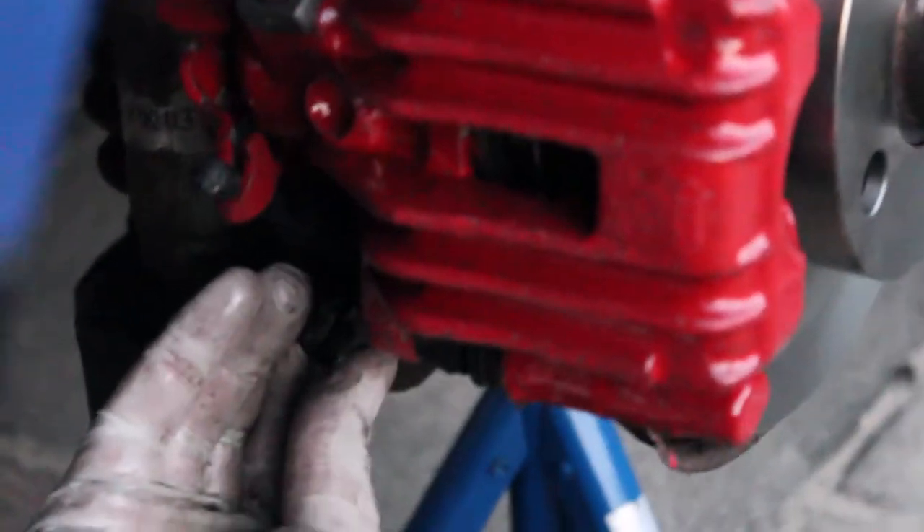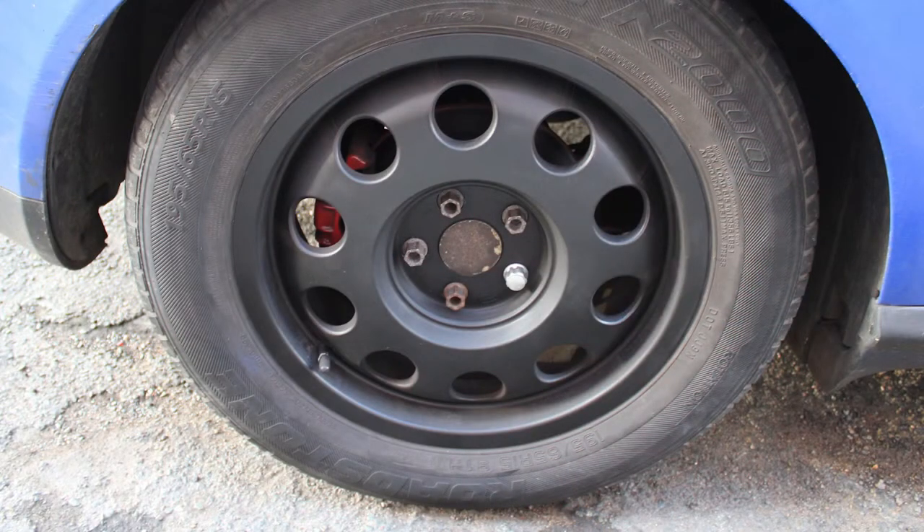That's it really — it's not the most difficult job changing brakes, but there were a few extra stages to clean out the rear arches. Once done the wheel looks a lot better: the red brake caliper is visible behind, the rear arch is protected, and the spring is sorted. Thanks for watching — leave any comments or questions below and hit subscribe for more videos. I'll be following up with a rear caliper rebuild video, as the root cause of all this was a sticking piston that wore the pad down to metal.